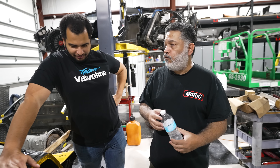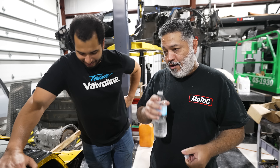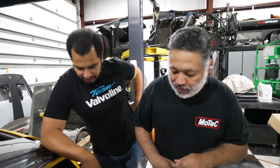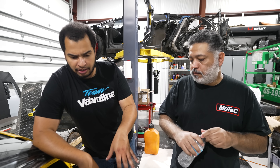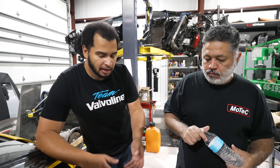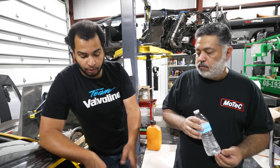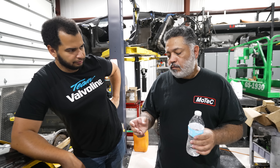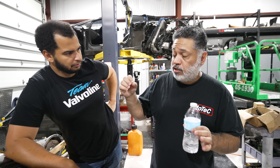You're gonna have 1,400 horsepower in this — it's called foreshadowing. There are 16 fuel injectors in this engine. It's a 720S engine, and the earlier iterations — especially the P1 — had only eight. The 650S, 675 all have eight injectors, but the 720 and moving forward they all have 16. Why would you have more injectors?